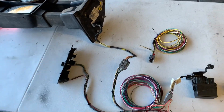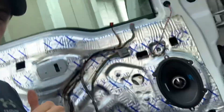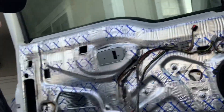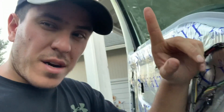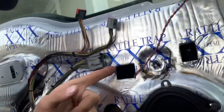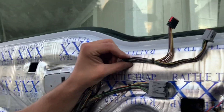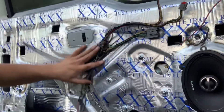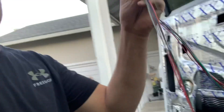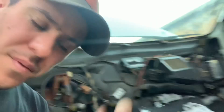Now we're back in the truck with our new harness. The new 08-style 16-pin plug mounts right back in the same spot on the '02 and up. If you've got a '99-'01, you need to cut a little square out of the door because your door doesn't have that opening, but the '02 and ups do — it clicks right back in. The switches are ready to be plugged in, already sitting in the right spot. The long leads are the ones that go through the door — I'll feed each one of those through the door.